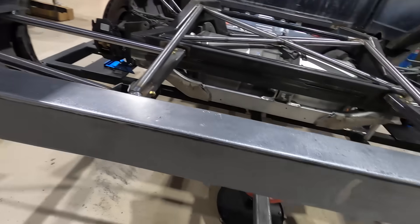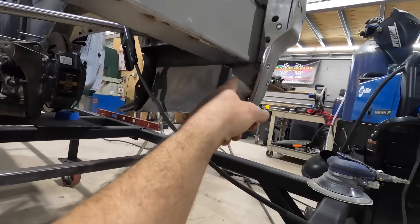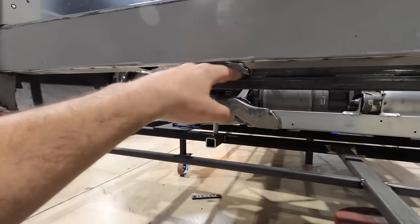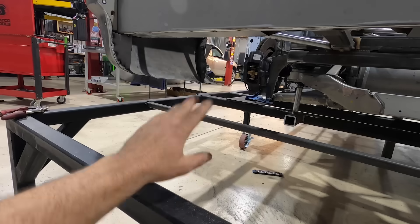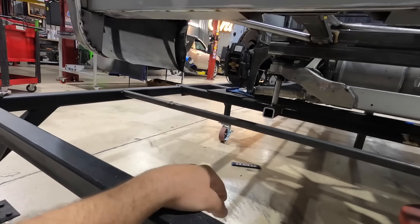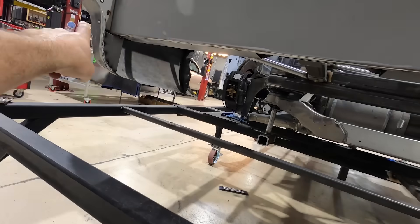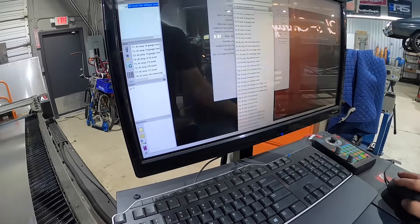We have our panel pretty much prepped and set, ready to start fitting our diffuser. We put these panels in here so we have something to cleco to, as well as underneath, and then we have that flange on the back side. What we're going to do now is rough in the diffuser by making the top and the sides, then profile to the edge of this bed with that nice swoopy edge. After that we'll fit the depth - how far out and how far in it sticks. We'll go over to the plasma table, cut our sides and top, cleco those in, take measurements based off the tailgate, trace our profile for the bed edge, and start making our side splitters that go down the side of the truck.